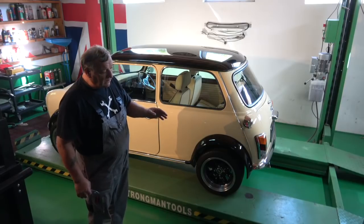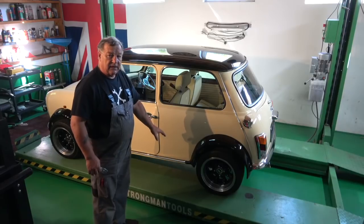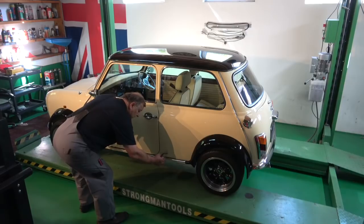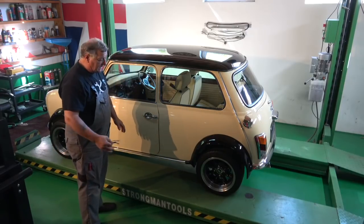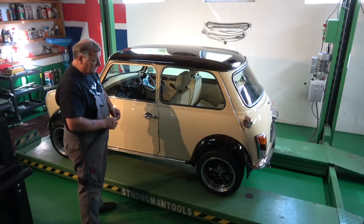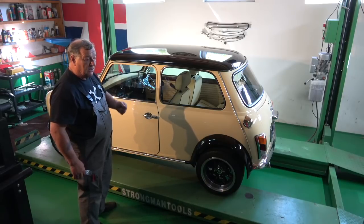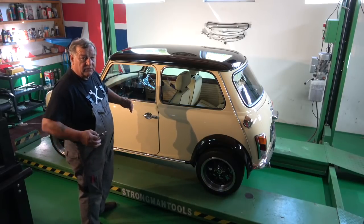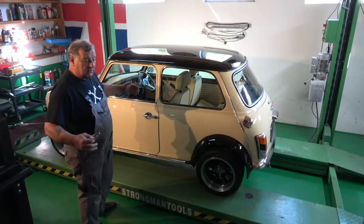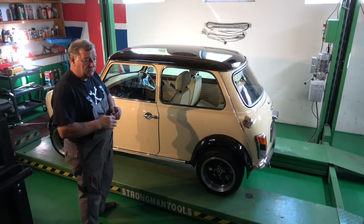Anyway, on this ramp, they have a steel ramp like I have here, but internally, inset in the ramp, they have another set of ramps, and it's basically to go into the centre of the car. The idea is when they're doing a test, they can lift the car up and check the suspension or do whatever it is they're doing, or adjust it. So I think what happened was he went to adjust it, found that the arms were a bit difficult to turn because it's trying to pull on the tyres. So he thought, I know what I'll do, I'll jack it up on the front, take the weight off the wheels, and it'll be easier, because they had to be adjusted quite a bit. You can imagine it was a brand new rack.